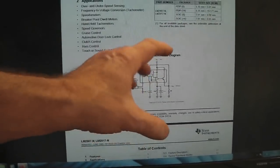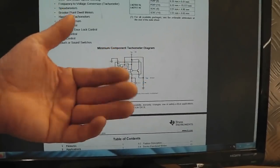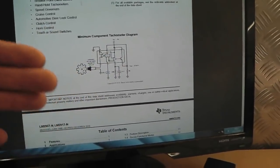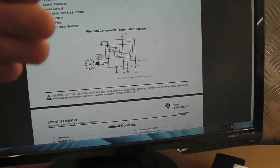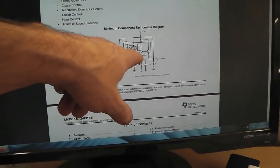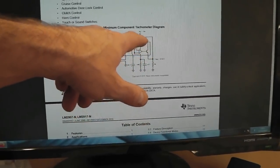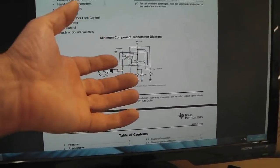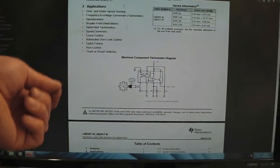So chips are all different. Every series has a different internal design, but if they're all the same number, they're all the same, and each chip can be used for different applications. You've seen us use those 4017 decade counting chips for counting pulses and creating time loops and time delays for the wipers. This is a little bit more sophisticated, or not as digital, if you will. This is to do with taking inputs and switching them under certain conditions, under certain rotational speeds, under certain voltage conditions.